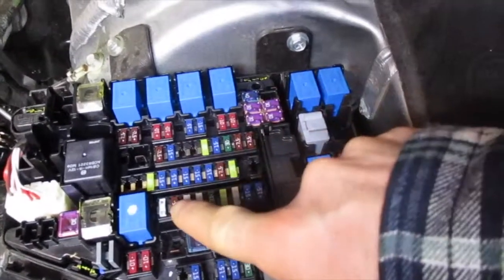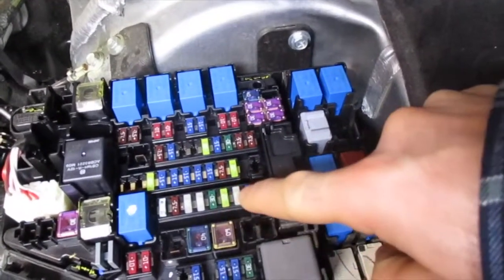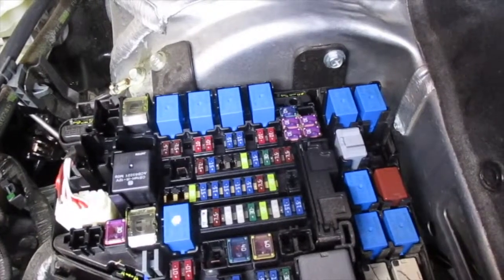You can come up here and these are your fuses. You can always take a fuse that is a non-needed component for running your vehicle and swap, say, this 20 amp fuse with this 20 amp fuse, or this relay with this relay, just to see if you can get those essential parts to work, or the part that you're just trying to check. And another nice feature is on the bottom of this cover, there's actually a diagram for all the fuses and relays.